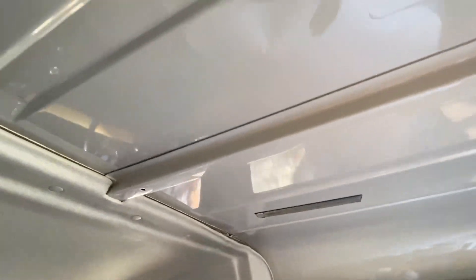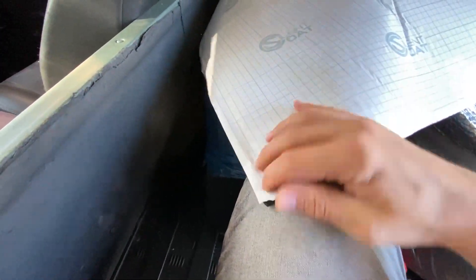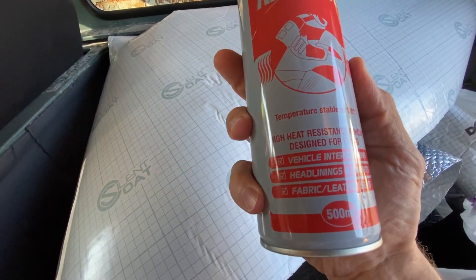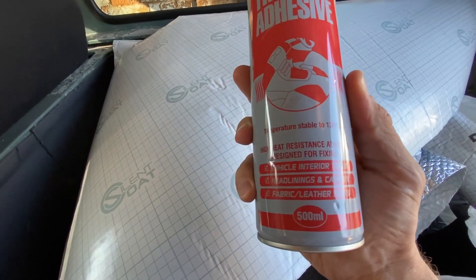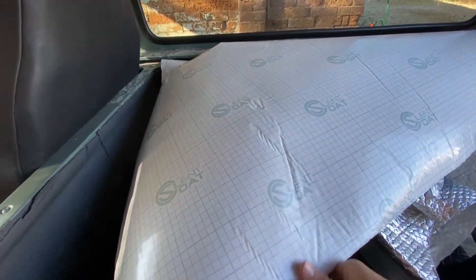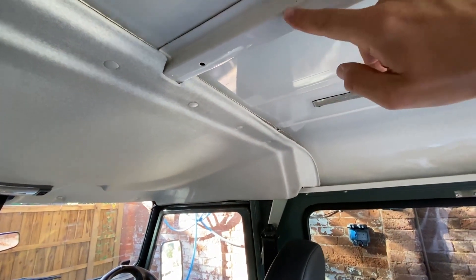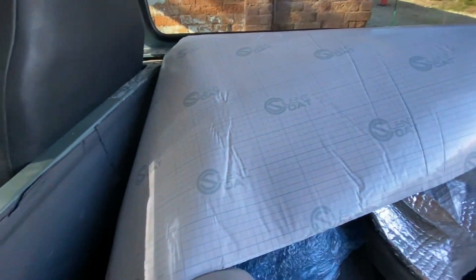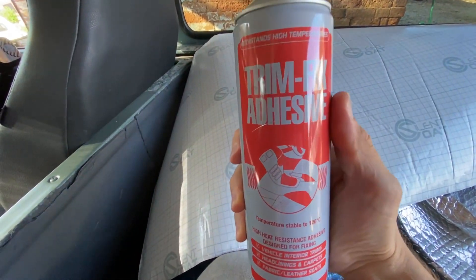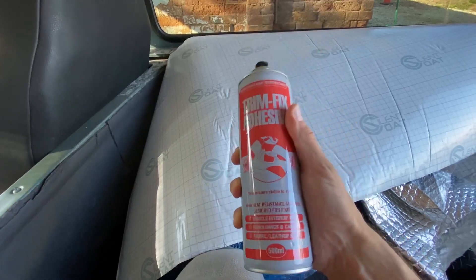Although the Silent Coat is really sticky, we're obviously going to alcohol-clean all the roof first. I'm also going to be using some Trimfix adhesive to get that extra bit of bond on the roof. This is a high heat resistance adhesive, which means it will stay on even when the roof gets really hot — which it will because it's black on the outside. I also don't want this coming off when there's condensation. I think I'm going to have to screw the headliner into the battens in the roof too, so I really don't want the foam coming off when it gets hot or damp. This is stuff you really don't want to get in your mouth or breathe in, so we're going to be careful when spraying it.